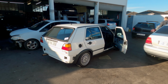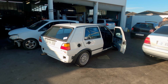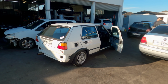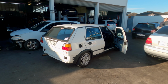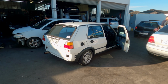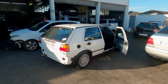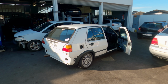Andrew and I just went over the logs, so that's quite sad. That last run that I did in the previous video, please go watch it if you haven't already, that was actually at full boost the way the car is set on pump now, and it is so slow. So Jameel just pulled a whole lot of boost out of it on top. So the car's just, yeah, it's sad. Really sad. So I'm going to do water meth a lot sooner. Like I'm gonna book it in soon, because this is no fun. The car just doesn't feel like it did before. It's safer, but it's too slow, so the water meth will give me more octane, more cooling, and hopefully I'll be happy with that. Or I might just run the car on eth all the time.